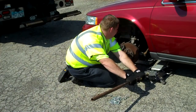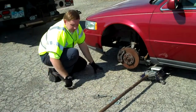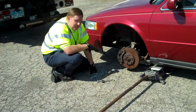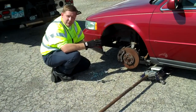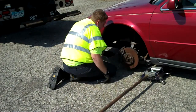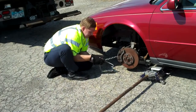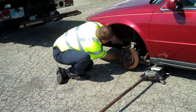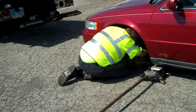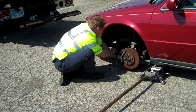We will lower the jack so the car rests on the Fourth Wheel Loader. At that time, we'll take our six-foot chain and our hand load binder and route it up over the A-frame or up over any main structural component of the car to attach the Fourth Wheel Loader to the vehicle so that it doesn't come off. Now that we have it hooked in the rear, we'll take the load binder, loosen it up, place the T-slot in one of the T-slot holes, attach the load binder to the chain, and then simply tighten with your hand.